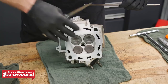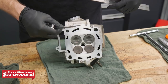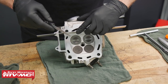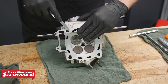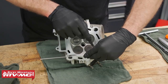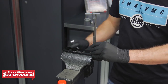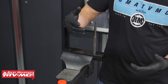The next thing you'll need to do — I like to measure for warpage before I take anything out, so I have an idea if I need to get the head machined. We'll get a feeler gauge that's the size of our service limit and a straight edge to check for any warpage. The easiest way I've found to hold the cylinder head is to use a punch and tighten it down in the vice using soft jaws.